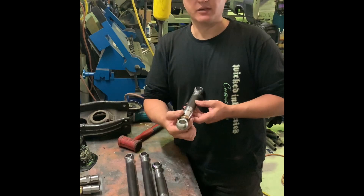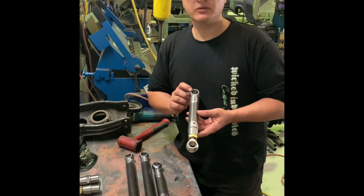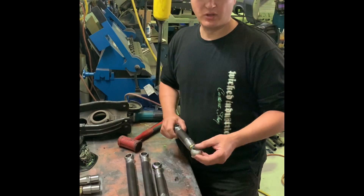What that does is it allows the rod end and the tube adapter to get a bit of heat into it — to basically preheat it before I actually weld right around that seam there. So let's get to it and weld them all up.